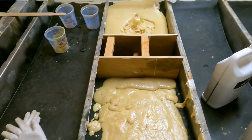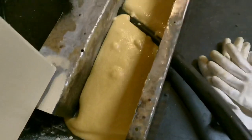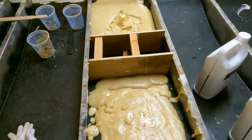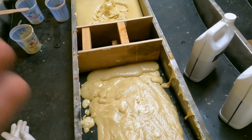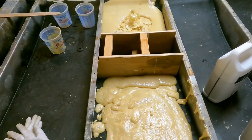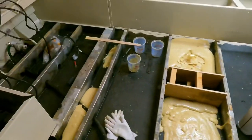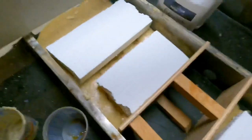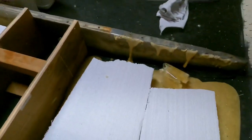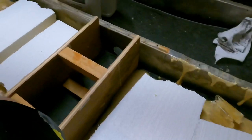Although it is working, it's not really rising to the extent I was hoping for. I tried another spot and it did better, but still not great. I've been doing a little reading — some people are using pool noodles as fillers, just cutting them up and putting them in the floor to take up space, instead of relying solely on this foam, because I'm already about a quarter of the way through and I have a ton left to go. I've cranked it up to about 80 degrees to see if we can get a little more out of the flotation foam.